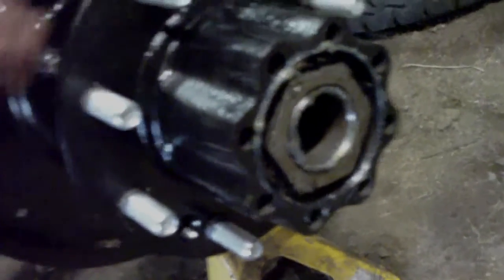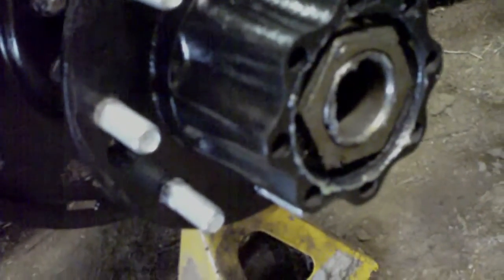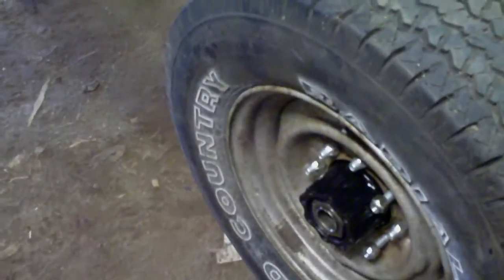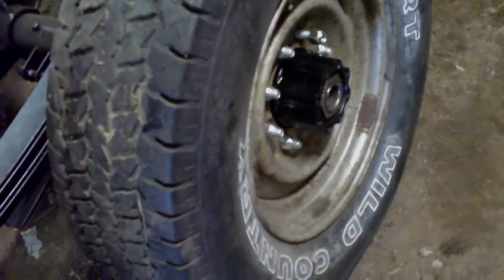I can't give any advice on the lock nut torque — this is the first one I've done. Just before you tighten anything up, make sure the hub rotates freely and you don't feel any significant end play. Personally I can't feel anything there, so I think it's pretty good. The hubs are all back on and I've got my tires back on. The lug nuts are on backwards — that's just because without the brake drum on yet, the nuts were bottoming out before the rim was fully seated. Until I get the brakes sorted out, I'll install the axle shafts next.